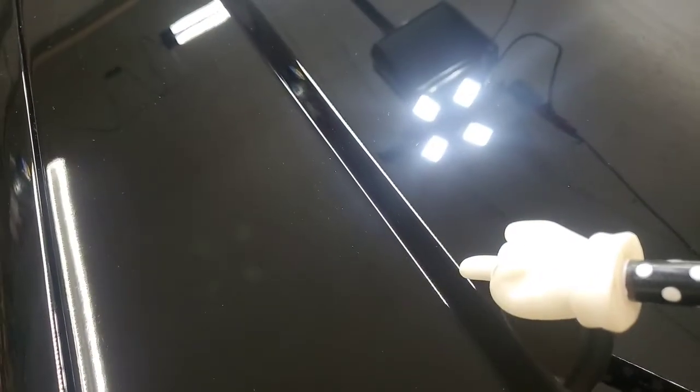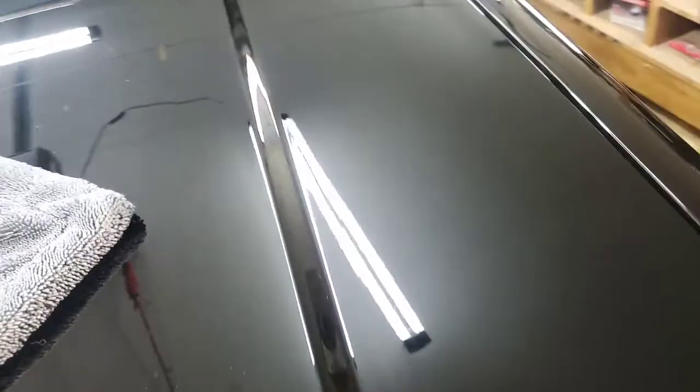Got over to here. Had to be, as I showed you guys in a photograph in a video earlier, I had all these ridges taped off, and then went back and hand rubbed those, because the paint can be much thinner on these ridges, character lines, some people call them, than it is over here. Oh boy, oh boy, oh boy. So you have to be pretty careful around those. Got down to here. Oh man. I hope the rest of the truck turns out this good.